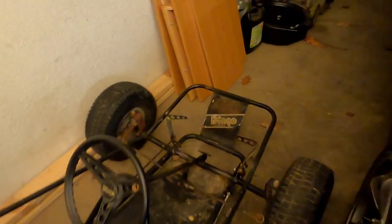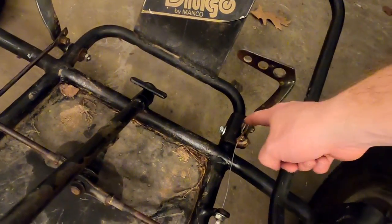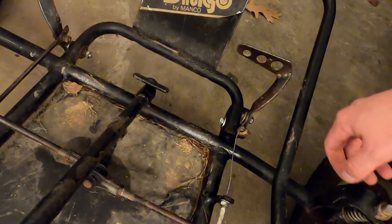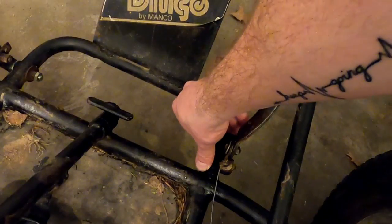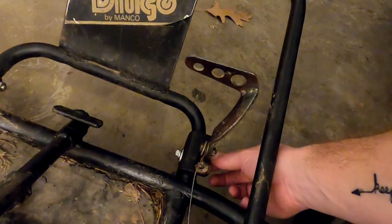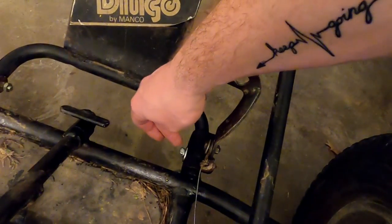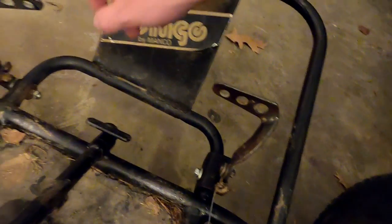Let's do non-pertinent stuff first. You know that I've been complaining about this — I don't like that at all. And I don't actually have any of the original return springs for the pedals. They're like 20 bucks or something on any of the go-kart sites. And my plan for this is I want to actually weld or at least tack this pedal stop onto the chassis so that's one less thing to move. And I'm actually probably going to weld a shouldered bolt to the pedal itself, or at least a washer — a 5/16 inch washer here, and on the chassis over here, so the bolt is a lot more sturdy. So there's less of this movement.